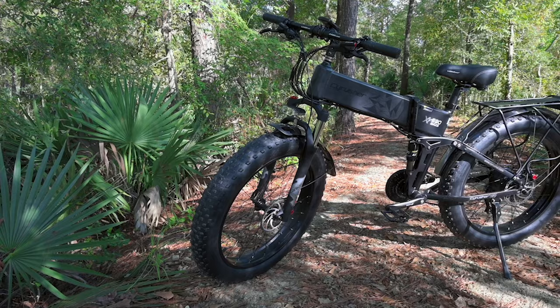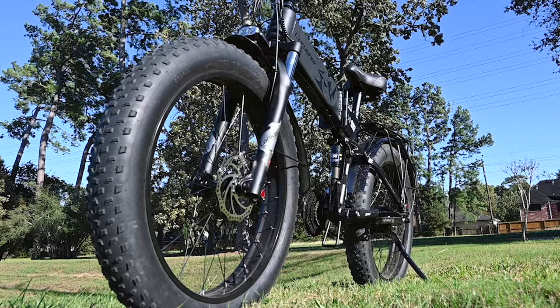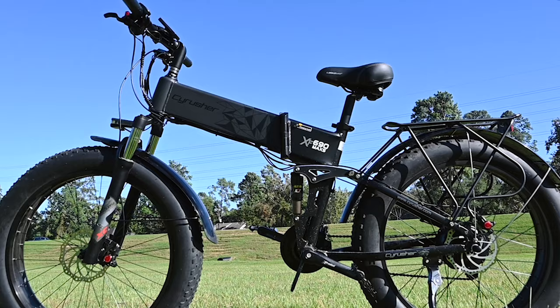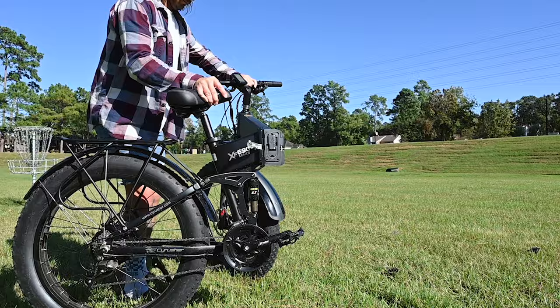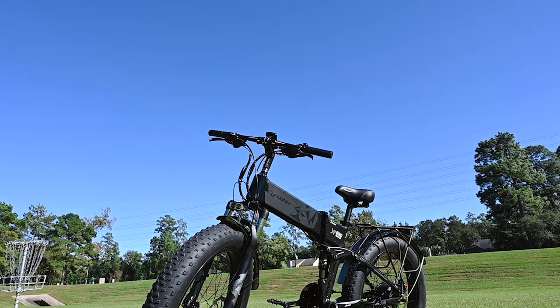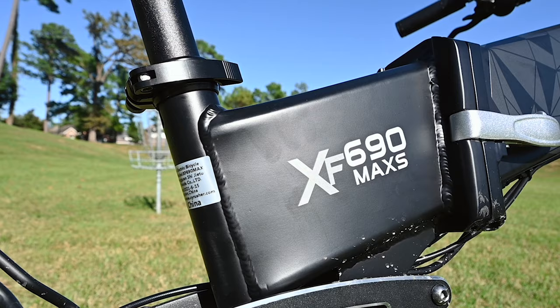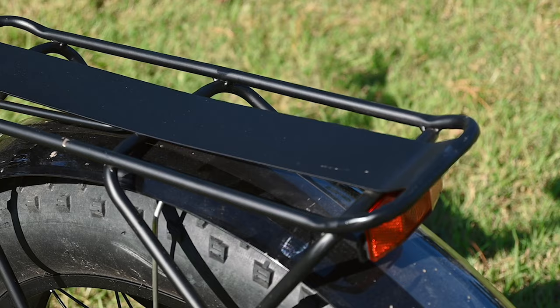Next, let's talk about the riders. This bike would be more tailored towards someone wanting to get off onto some trails and into the woods. It's got big four inch tires, so handling off-road is no problem. One thing to factor in is the weight and the standover — someone 5'10" and up would be better suited for this bike, with a standover height of 36 inches. Someone who also wants the ability to fold it up and load it into a vehicle would find it a great option too — just remember it weighs about 66 pounds. If you decided to use this as a commuter, the back rack is a cool feature and you could hop off the street, get into some trails, and make your commute a little shorter and more interesting.